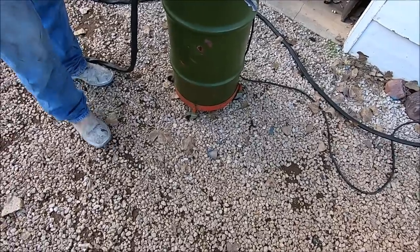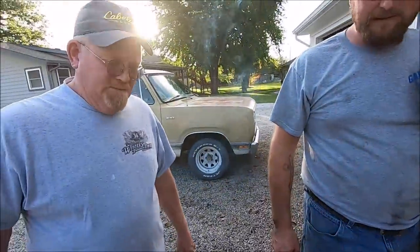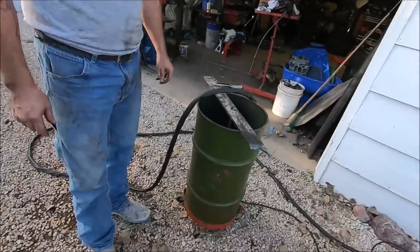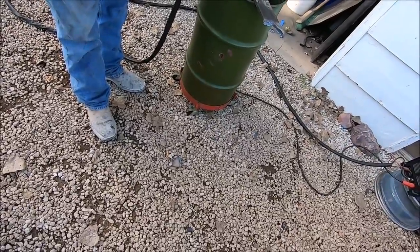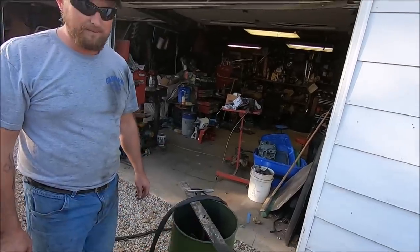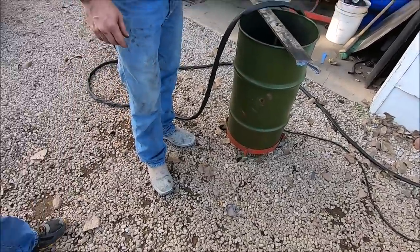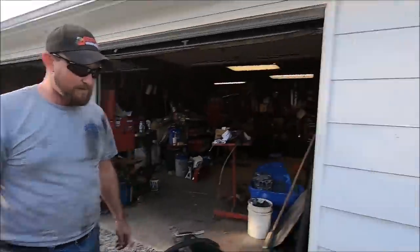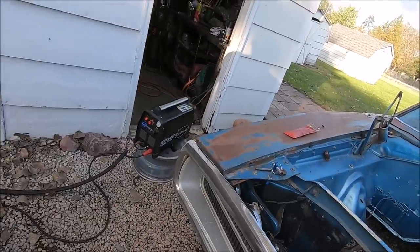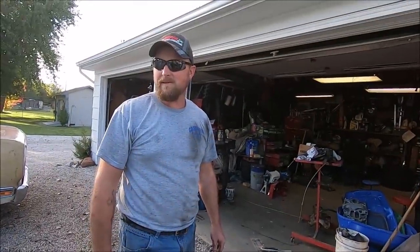You said it wouldn't do 3/8. Well, it ain't. It cut 3/8, but it wasn't happy. It's probably right there on its edge. I think that was past its edge, because it should just blow through instead of sitting there melting it and finally cutting through it. Maybe we didn't have enough air. Well, you did mess with the air. I had it set up where it was happy, and then 100 PSI on the compressor, and the welder down here is a whole different deal. Why even have a regulator on a compressor? It's like an air arc. More air is better.